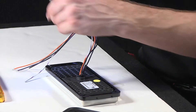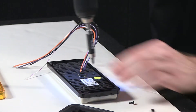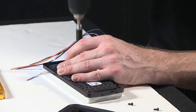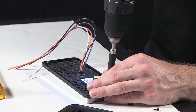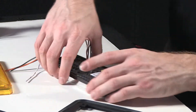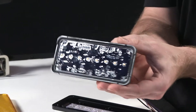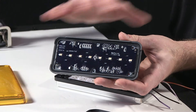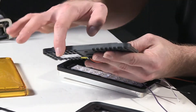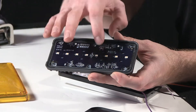A total of six small Phillips head screws are going to come out now to free the diode board from the front reflector assembly. With a bit of a wiggle and push, the diode board is freed. Eight diodes are what gives you your 700 series potency. They've been affixed into a complete board assembly here — this is a metal fixture that acts as a heat sink.